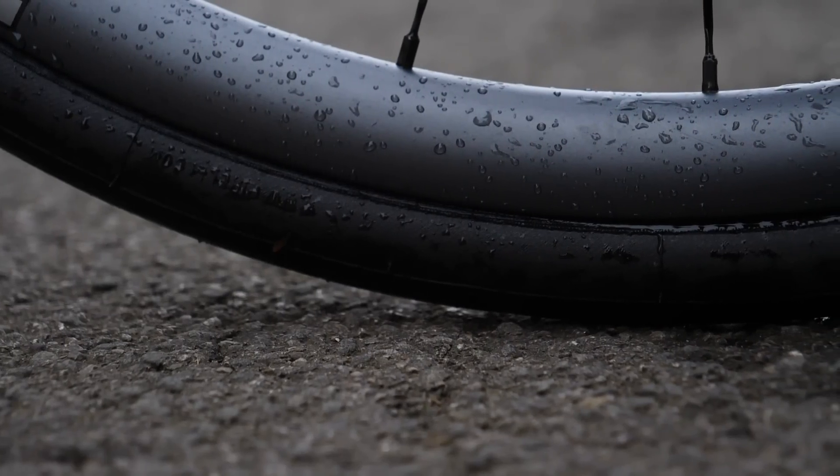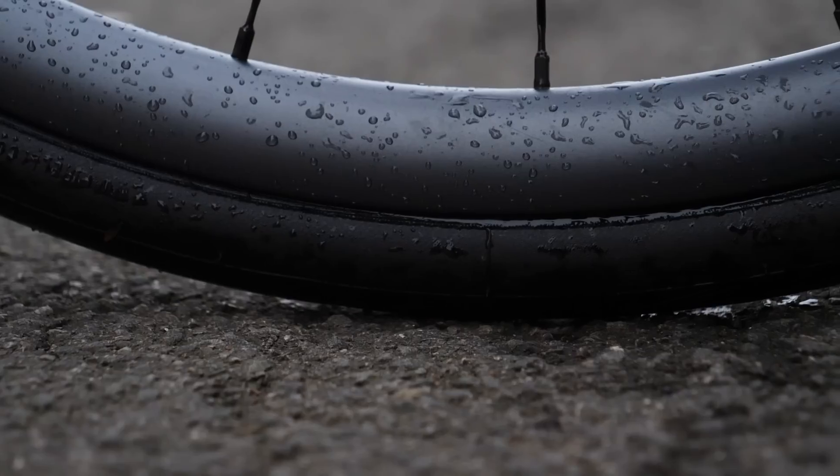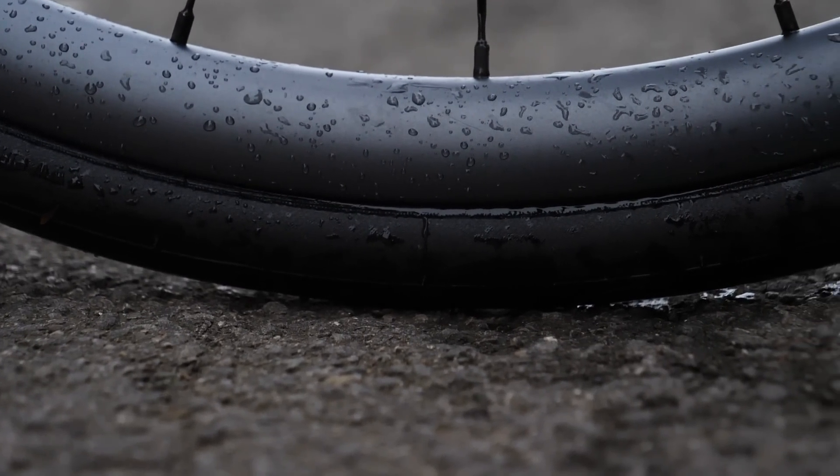The difference in height might be noticeable in a crosswind situation when the wind's hitting the wheel from the side, and that deeper wheel will catch the wind a little bit more. A front wheel does have a big impact on aerodynamic characteristics. We've seen examples where big teams like Jumbo Visma or Team Ineos moved away from their wheel sponsors to use a specially designed front wheel for time trial situations, such as the AeroCoach TT front wheel with fancy aerofoil hubs, because the front wheel does make a big difference.